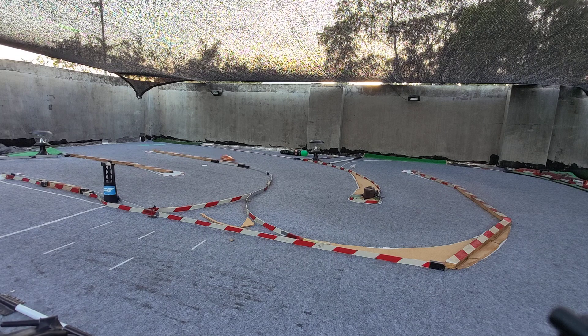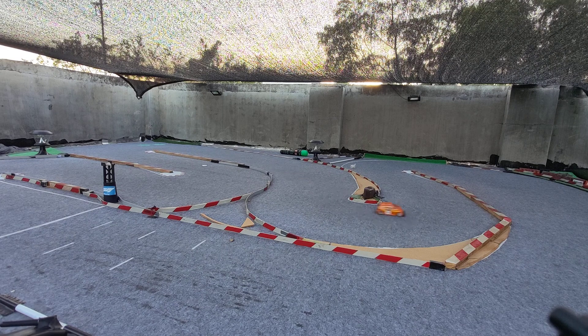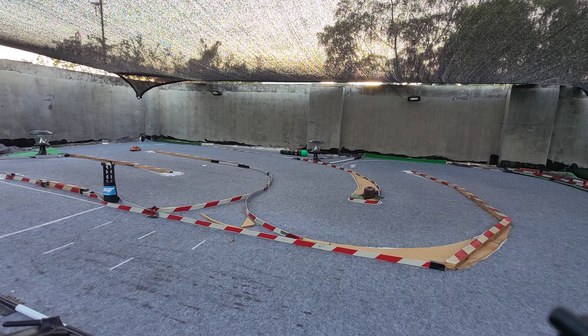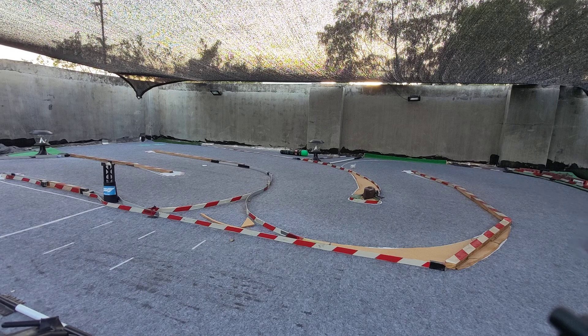It is very beneficial, I can tell, to the car hopping around. But at the same time that I have gained a little bit of dampening at the rear, it seems to have increased my understeer quite a bit. So I'm not really sure this is a great place to test the performance — right now what I want to see is mainly the functionality of the damper.